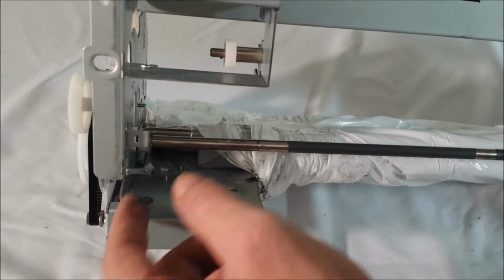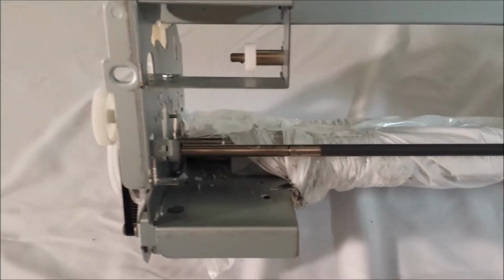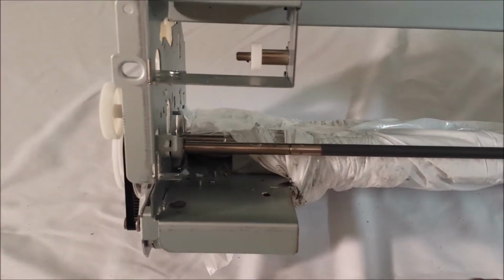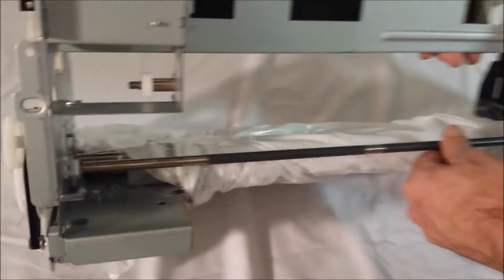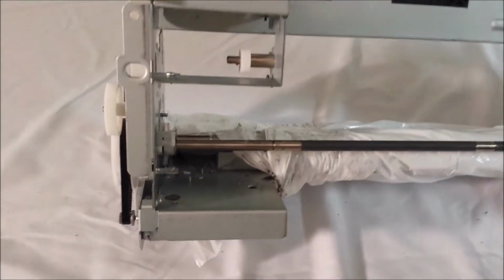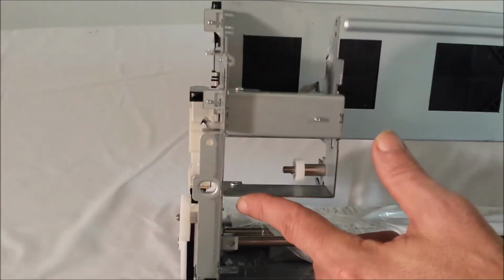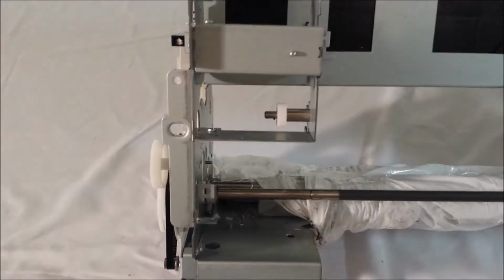Like I said, your motor will still all function as normal, and we want it to spin just like it normally would in a normal printer, except we're pulling signals off that, using an industrial motor to drive our platen. So we have no need for the friction drive, just only to process the signals. So we'll go ahead and remove these screws, cut the shaft, and go to the next step.